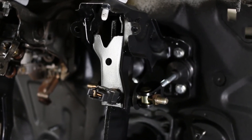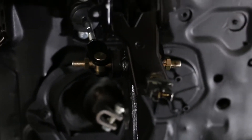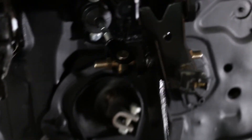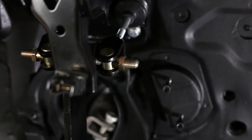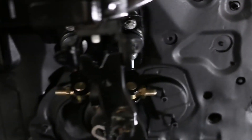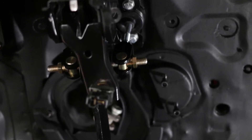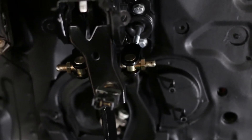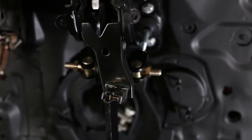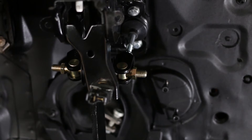The basic idea is there's a ball bearing and a balance beam. You can actually see — pretty much anything that looks like copper in this is the kit I'm talking about. As you move that bar to the left or the right, you're adjusting the balance. You'll see as you apply the brakes, it'll actually apply an angle — you can see how the angles change. That bar lets you adjust the bias between the front and rear brakes mechanically, without even getting into a proportioning valve, which you can also do.